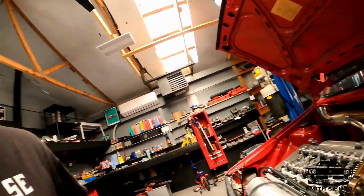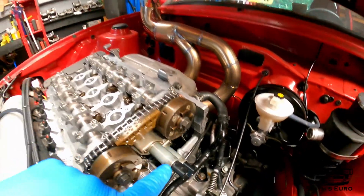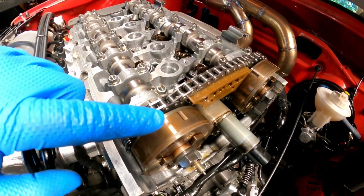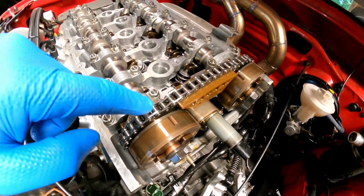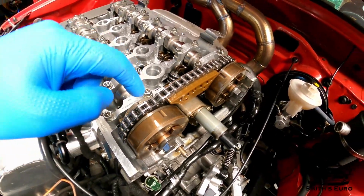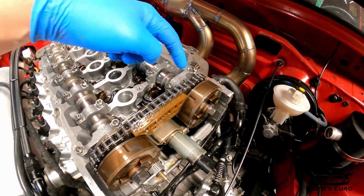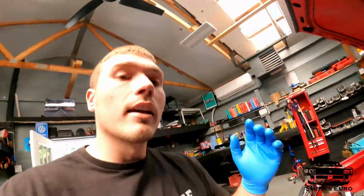Ensure that you mark everything before. So I'm going to mark everything. We have to take these apart. So we're taking these apart and putting the Schimmel gears on, but to make our lives easier, we can still mark this chain, because there is a certain amount of links. I believe it's 16 links between these 2 points on these cams that have to be identical. So just save yourself the headache, clean everything off with brake clean, and paint everything.